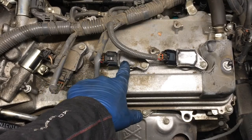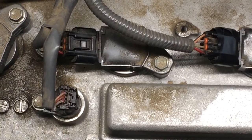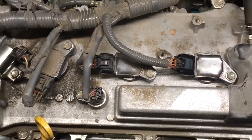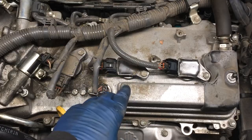I'm going to show you how to do one coil and plug from this up front, and then we're going to jump straight to the back. The first thing we want to do is disconnect the electrical. Now I want to make a note real quick. If you think that you're likely to break your electrical connections because they're real old or you get started and they just already are getting crazy,